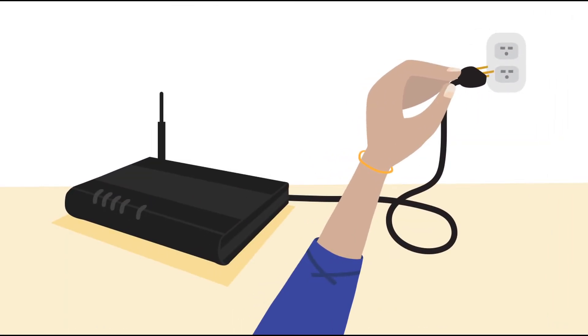Method 2: Power Cycle or Resetting Your Router. Follow these steps to power cycle your router and modem. Unplug the modem and router from the power outlet and wait at least 15 seconds. Plug the modem back into the power outlet first, wait 1-2 minutes, then power on the router. Wait for all panel lights on your cable modem to become green before testing your internet connection.